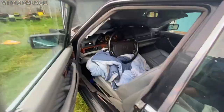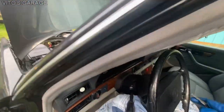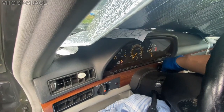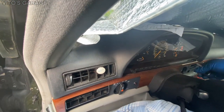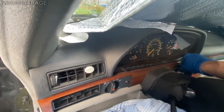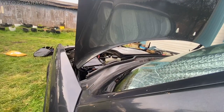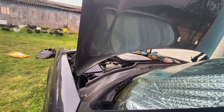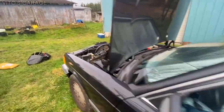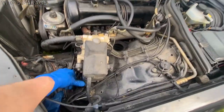Alright, I'm just gonna crank this car right now — it's not gonna start, but I want to crank it because I need to clear out that spark plug hole. Let's see — just gonna crank it a few revolutions. Okay, that's it, and then I'm gonna go ahead and reinstall the spark plug.